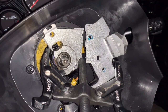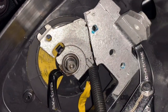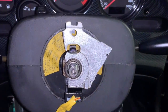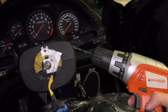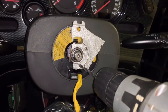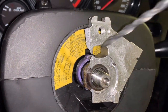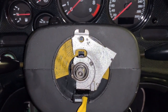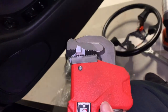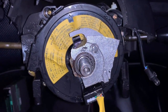I just broke another piece. Is this the hardest steering wheel to remove? What I'm gonna do is drill some holes around here and try to get some material out before I can access the edge of the washer. This is really a pain in the ass but we're getting it done. I'm using every possible way trying to get this off. The steering shaft - oh my god, really hot.